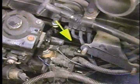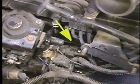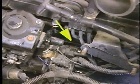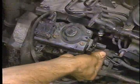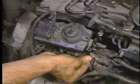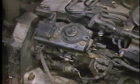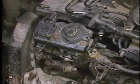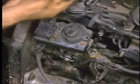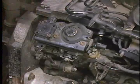Disconnect the fuel drain manifold line at the rear of the pump. Next, remove the hold-down clamp bolt that retains the line; the clamp is located behind the pump high-pressure lines. Now disconnect the two wires to the fuel shut-off valve, disconnect the wire to the KSB solenoid, and for vehicles with an automatic transmission, disconnect the throttle position sensor electrical connector.